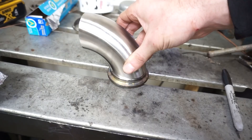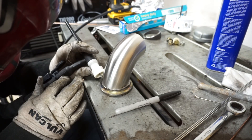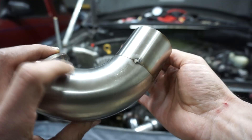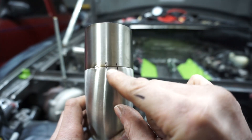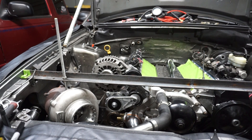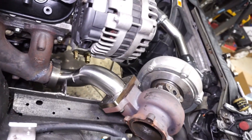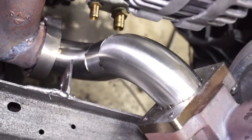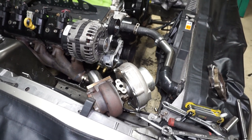I'll pull my v-band out and tack it up. Here's the piece coming off the v-band — I did tack another section on. You can see I just marked it with two lines. Usually when I test fit I'll mark it in two spots as a reference point, then take it on the bench and tack it in place — I didn't really want to move my welder back and forth. I've got both turbos hanging now. You can see the little bracket up top isn't holding them anymore. This side is just tacked into place and I think it turned out pretty well — you can see all the little tacks around there. I'll fully weld it, then we can start getting into wastegate positioning and building the intercooler piping.